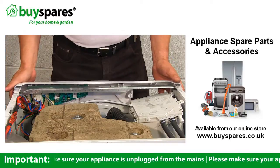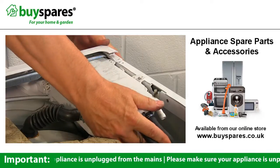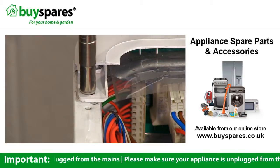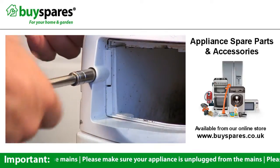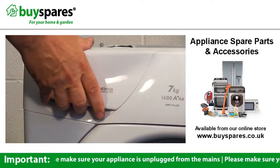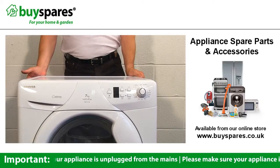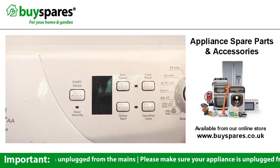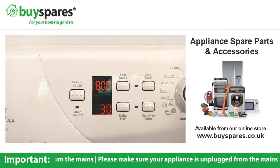Replace the control panel and reposition the soap drawer into place. Rescrew the control panel and the soap drawer. Lower the lid onto the locking pegs for screwing in position. Reconnect the machine and run a short test cycle to ensure the machine is working correctly.